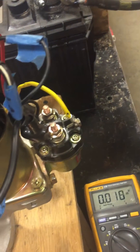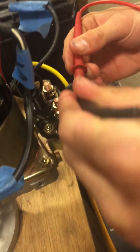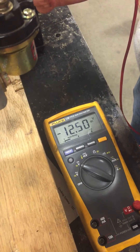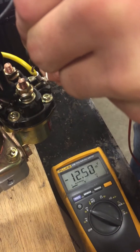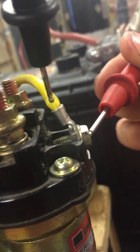Do you want to get closer? Test an end. Come on over here and test an end. We're going to test terminal to wire and see if we can get the same open circuit terminal to wire. So we just stabbed into the wire, activate the circuit, and I have 12.5 volts. That tells me I have an open between my leads — between my leads is the terminal. I have a bad crimp.